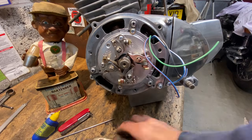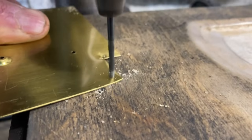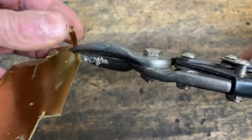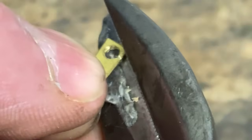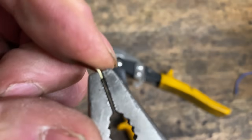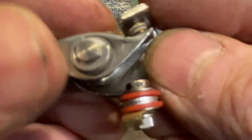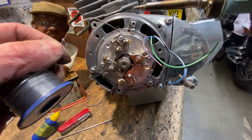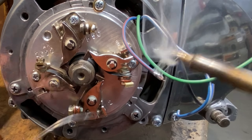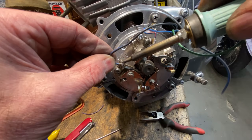The gaps are a bit big but I'll be setting those later with the feeler gauge. The next thing I need to do is cut the four wires down to length and solder them onto the points, so first I make some brass tabs from half-millimetre thick brass sheet. These go onto the points for the wire to attach to. With the brass tab bent at the end and fitted, I can now solder on the wire. To make things easier with just two hands, I tin the brass strip then tin the wire, then bring the two together and melt them. That's the first wire soldered — cylinder number one — just got to repeat the process for the other three cylinders.